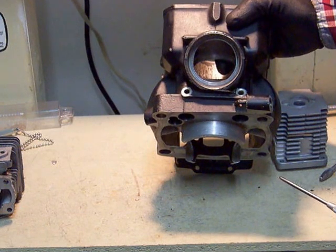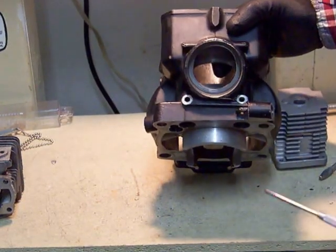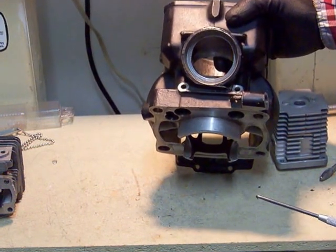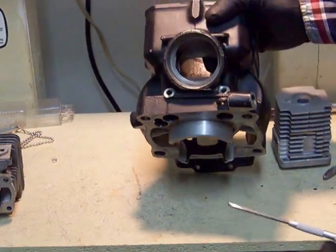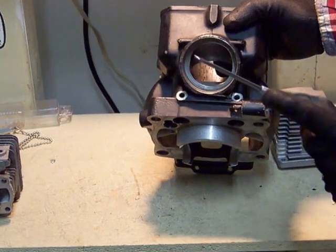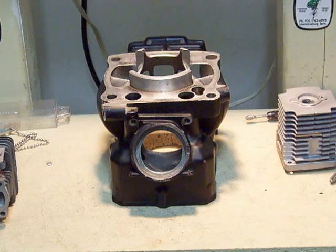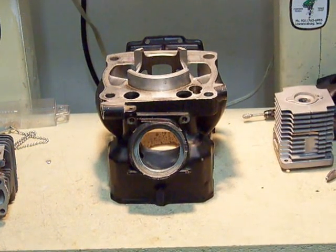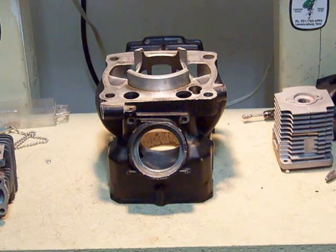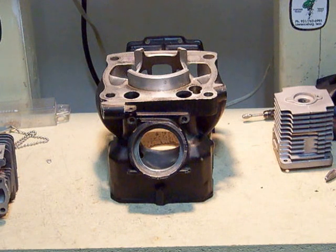I hope that helps you understand a little bit about the exhaust port. The timing — the degree of rotation when this opens and what RPM your cylinder is tuned for — gets complex. I recommend reading it over in my Tips and Techniques section, as it can explain it more fully. It's based on the principle that the reflected exhaust wave takes about 0.003 seconds to return. I hope this has enlightened you a little more about two-strokes. You can find more online at ccspecialtytools.com, or reach me at twostrokecentral.com, which is a great forum for two-stroke enthusiasts who want to get into tuning and building.